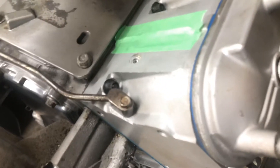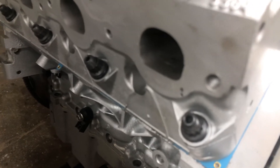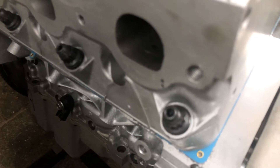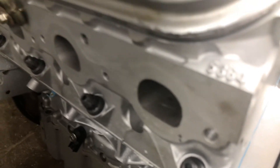You can see here my screw-in head studs. There are nuts for the small bolts on the top that I torqued down to 25 foot-pounds, and there are studs on the other end there. It's kind of dark but you'll probably see it better on the other side. Excellent studs — I've got them torqued down to 80 foot-pounds. They look nice and clean and don't seem to be impeding on anything else like the headers or spark plugs.